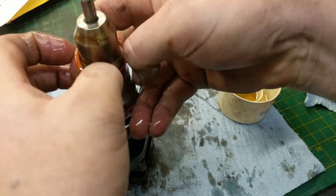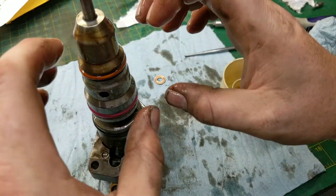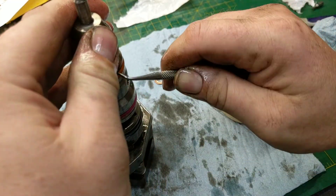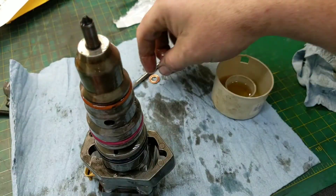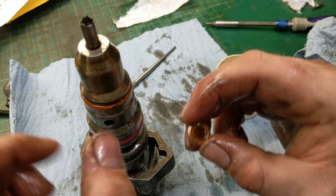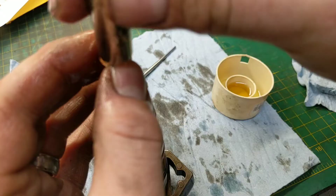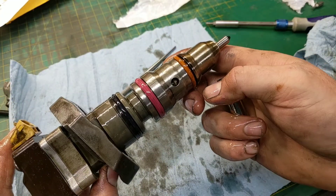The last o-ring is also kind of tight — make sure it doesn't roll. This one has a seam around it so you can visually inspect to make sure it's not twisted. If it is twisted, take your dental pick, work it behind the o-ring, and run it around — it'll straighten itself out. Then the crush ring — you can't reuse the old one. I like to put it with the indent facing down. Set it on top; it won't slide on easily, so take a 3/8 socket, put it on top, and give it a bump — it'll fall right into place. The injector is now ready to go back in.